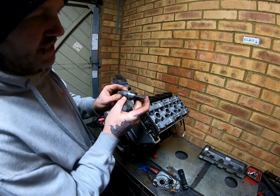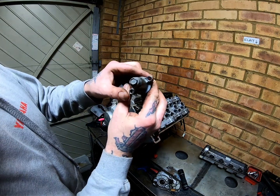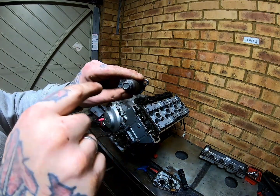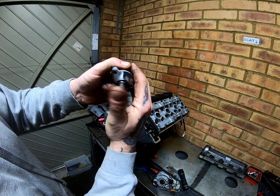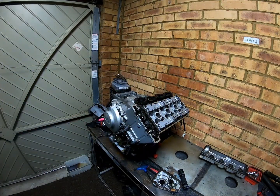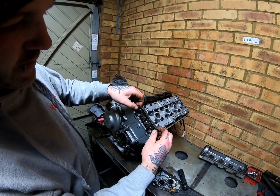So that's that. As you can see, the plunger is that. We've got our up part just there. Right, so we remove this bolt when we come to refitting it. Flathead screwdriver in there, wind it in. This comes in. As you can see, it won't move in, not at all. It's on a ratchet system, so it'll easily come out, but it won't go back in. And that's how that works. So that's the chain tension off.